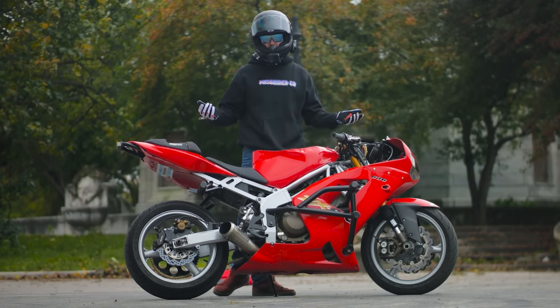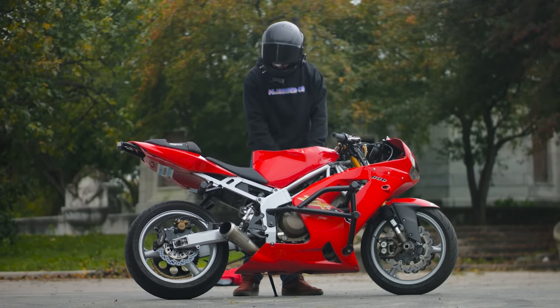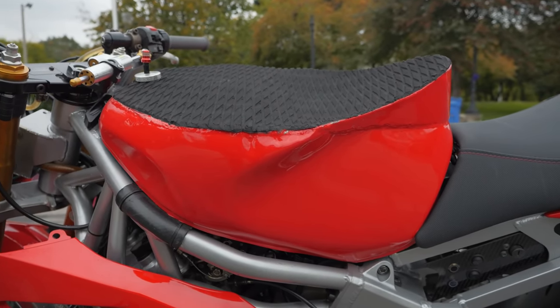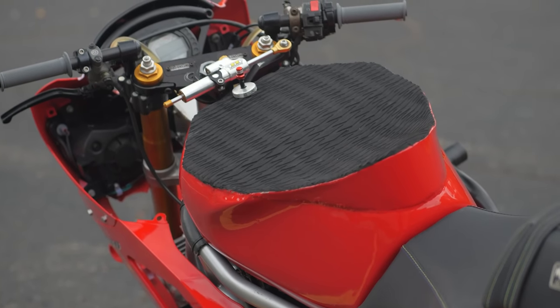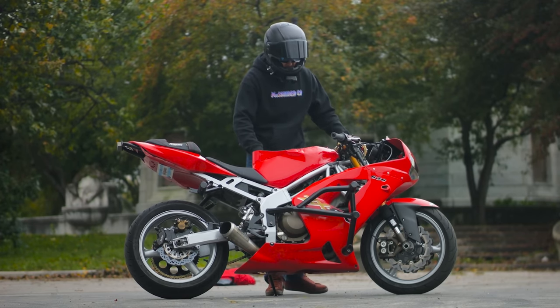It comes from Europe and is really hard to find. I have a steel welded gas tank — we take a stock gas tank, chop it off, have a custom fabricator re-vent the tank, and put a piece of sheet metal down to form what I like to call half a cut, half a bowl. I kind of like the dented-in tanks, but I do like the fab tank, so this is a good happy medium.